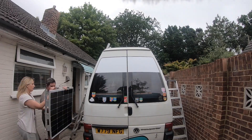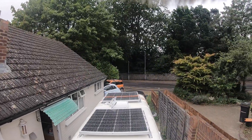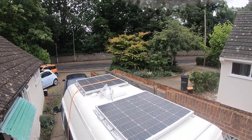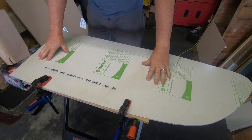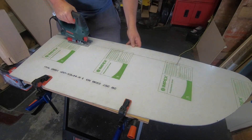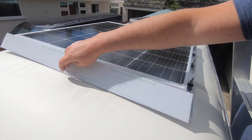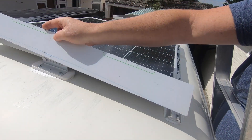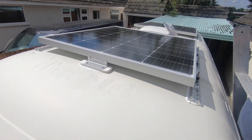Unfortunately rain has stopped play yet again. Anyway, let me show you what I've done — I've got two solar panels on the roof. Yeah, I'm pretty happy with that. So what I've done here is taken a piece of polycarbonate sheet and marked out a wind deflector that I'm going to cut out of this. I need to cut this curve into it so it sits flush with the roof and with the top of the solar panel — let's see if we can stop the wind from getting in underneath there when we're driving at 70.